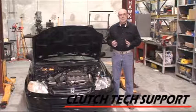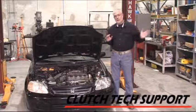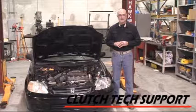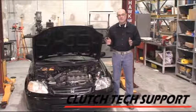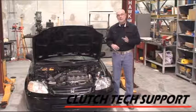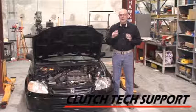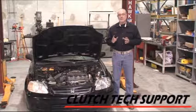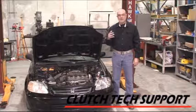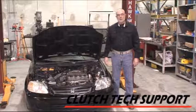If you get in this car and try traditional brake bleeding — just pump the pedal and open the bleed screw — it's not going to work. There's not enough volume in the master cylinder to cycle fluid all the way through the system, plus you've got a high-routed line across the back of the firewall and over the transaxle. We did utilize the factory recommended service procedure — push the clutch pedal with the bleed screw open, close it, bring the pedal up, and repeat. The best we were able to get was about one inch of free play at the top of the pedal. When we added the vacuum process, starting with a completely fresh system, we got it down to about a half inch. That meant there was a trapped air bubble that the standard procedure just couldn't get out. If you have any questions about a clutch, flywheel, or hydraulic system, please call our toll-free clutch tech support hotline.